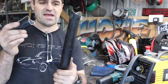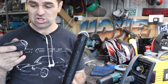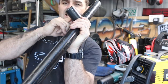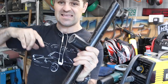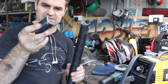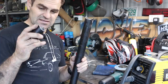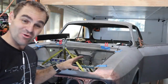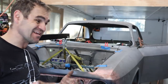I've been playing around and I've got my two fish mouth ends — one for either side. These are going to cap onto the cotton reel mounts that are on the car already, and tack onto them. The other end I've got to adjust to length so that it lines up with the plate on the engine I made previously. Now it's time to get the engine back in the car, get it all lined up, and start trimming these to length and tacking them in. I've gone through how to make fish mouth ends before in my roll cage videos if you want to see how — quite handy to know if you don't have a tube notcher with a hole saw, which I don't. After a lot of playing around the engine's back in, all lined up, the gearbox is bolted back on, so now I'm going to trim down that fish mouth piece and see if I can actually fit it in.